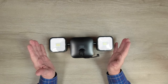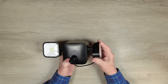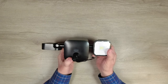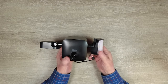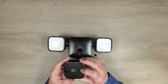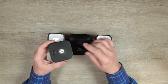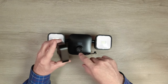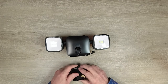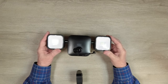The mount has two LED floodlights on either side that are incredibly flexible — you can move them in almost any position, straight up or straight out. Each is independently movable, so you could point one down at the walkway and the other toward the garage if there's suspicious activity. On the front you'll find the volcano mount that matches the hole in the back of the camera. You line it up, push really hard, and it pops on securely. The camera can then be positioned to look down a pathway or over a fence.